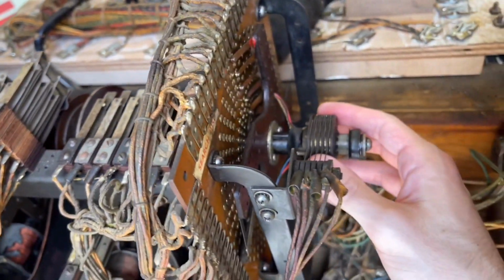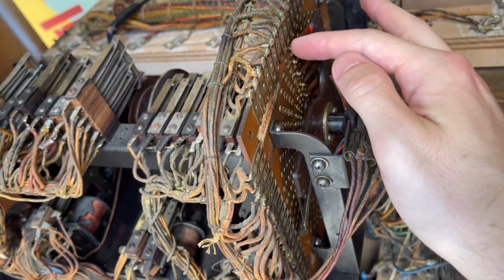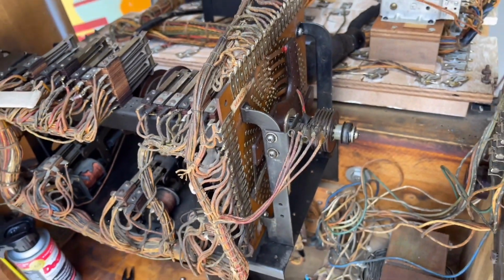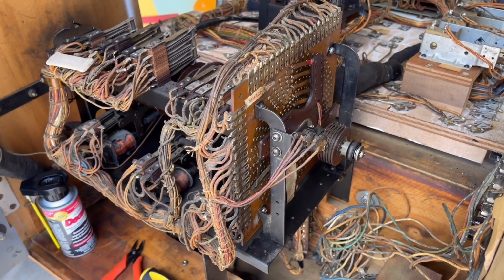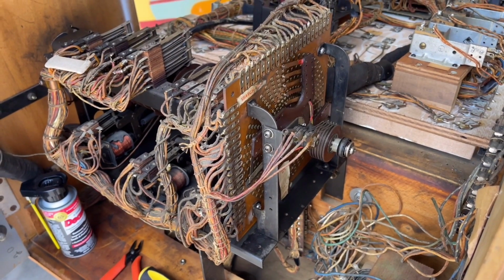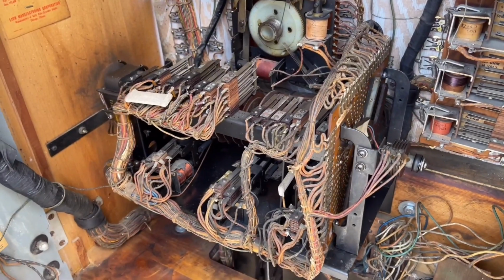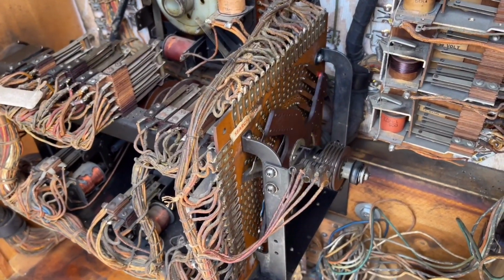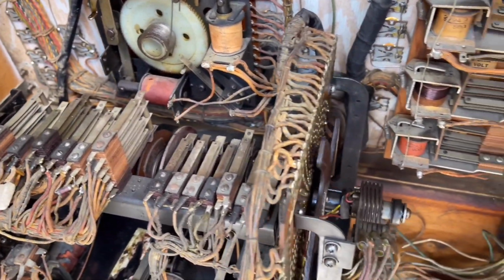That is the reset for the score multiplier unit. And now it happens when wiper A is at 0. So now the search disk is back in the correct position. So let's go ahead and plug the game in, turn it on, and we'll see if we have a fully working game now. All right, I have the game running now, and as you can see, the search disk is working. So there were no issues when doing this repair.